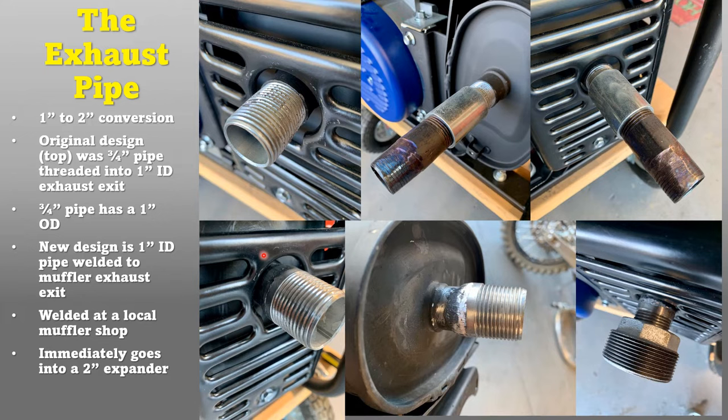These pieces are actually conduit pieces — also known as EMT or electric metallic tubing, used for wiring conduit. They work well for this application since they're metal and should withstand the heat. Theoretically the heat out of this exhaust could reach up to 600 degrees Fahrenheit, so I didn't want anything in there that wouldn't stand at least 600 degrees. The pipe just shoves in and you tighten a screw that clamps down on the tube.